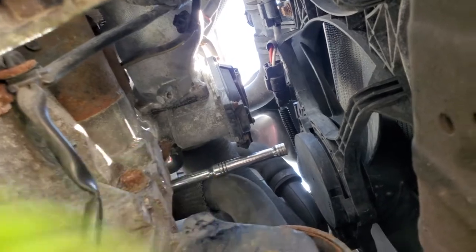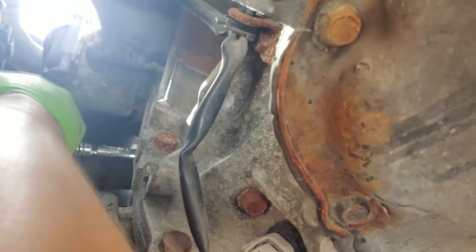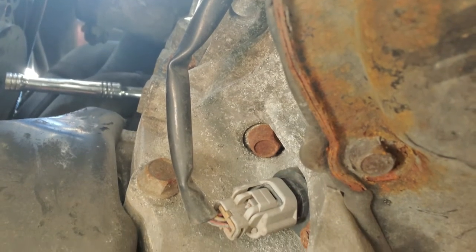To show you quickly — I had my ratchet right here, and because I don't have much leverage I used my body weight and moved like this. I loosened the last 14-millimeter bolt using all my body weight to move the torque. It's not so bad because it's a 14-millimeter, unlike Hondas or Acuras where it's a 17.